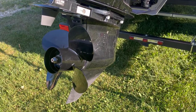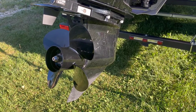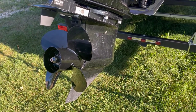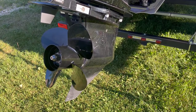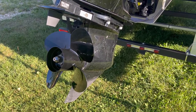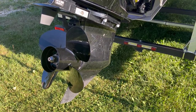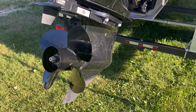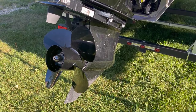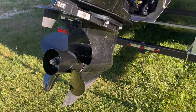It's a little bit less RPM but still enough that the engine's in that optimal range when it's maxed out. If you're sitting at something like 6,000 plus, that prop is not right — the engine is spinning too fast. And if you get into the 4,000s and lower when maxed out, that's referred to as lugging. I think of that the same way as an old four-stroke dirt bike just chugging away — in too high a gear. The engine is not super happy over a long period of time, so you don't want to be maxing out at too low an RPM because you're lugging.